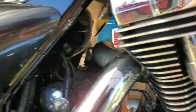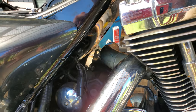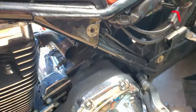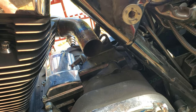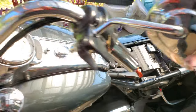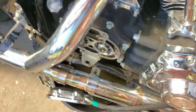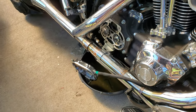Because we have this crossover — and I apologize, I don't know how well you can see it with mine disassembled — I absolutely ended up having to remove my left exhaust completely. I lost a bunch of time trying to sneak things through that just were never going to happen. So I'm just letting you know: just suck it up, pull off the left side. It sucks, it takes a little bit, it's annoying, but you can do it. Just pull that thing and get yourself all the room you need.